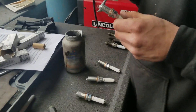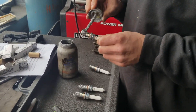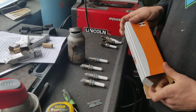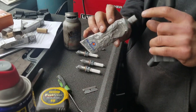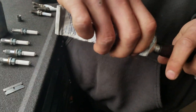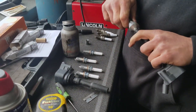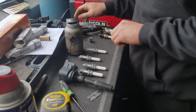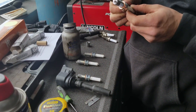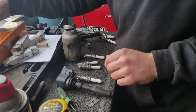For prepping the coils, you want dielectric grease — put it in like this at the tip. How do those plugs look compared to the other ones? I went with a different brand. A little different, but NGK is quality. I like NGK — I put them in all my performance builds.